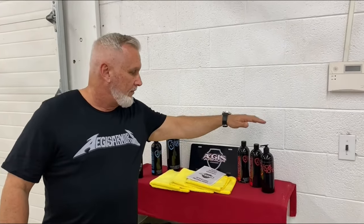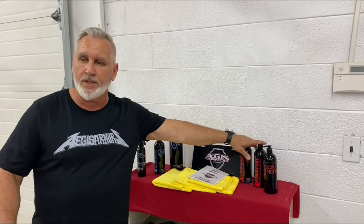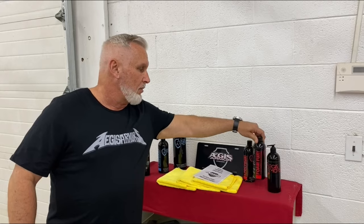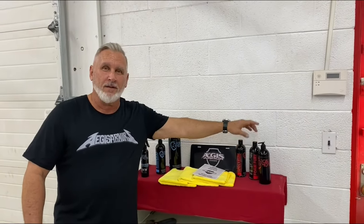With every vehicle we provide a video on how to wash and maintain it. Every couple weeks, you'll take a pressure washer and rinse the vehicle off. You use our Aegis Armor Foam Fury or Spectrum, which is ceramic-based soap. You'll apply these with a foam cannon, let it sit for about a minute, rinse it off, and then take a leaf blower and dry the vehicle.